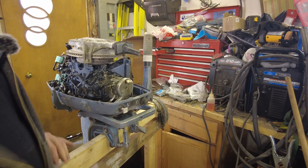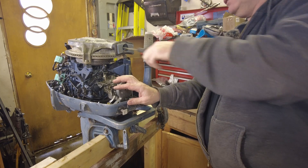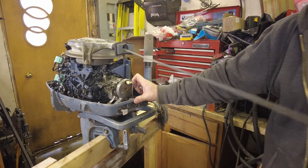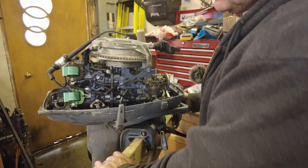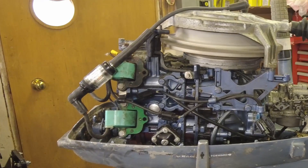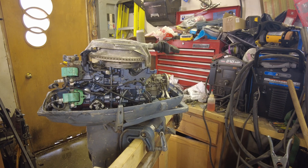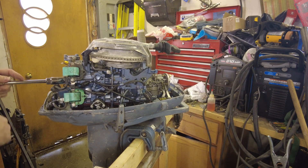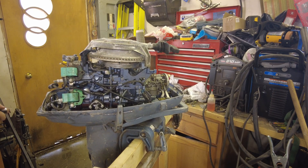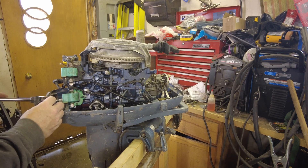I think we're good there. I would say the recoil is going to need to be cleaned up. Now let's pull it over and see if we get any kind of spark. Oh, we got spark there — try the other cylinder. Nice bright spark there. I'll put the plugs back in and hook everything back up. I think I'm going to have to figure out a way to put some water to the lower unit of this motor. I fully plan on changing out the water pump, but I know that outboard aficionados will absolutely lose their minds if I fire this thing without putting water to the lower unit. Let's do it right.